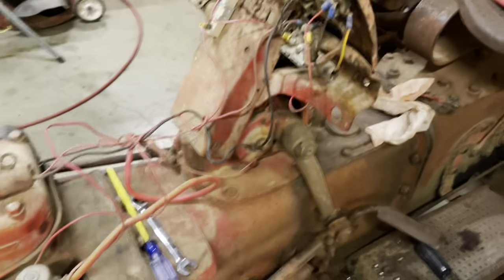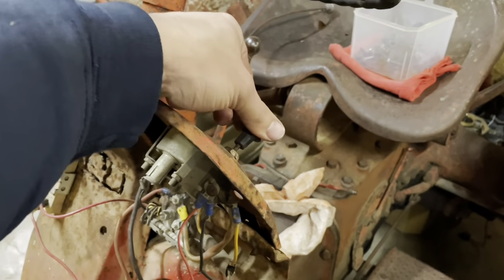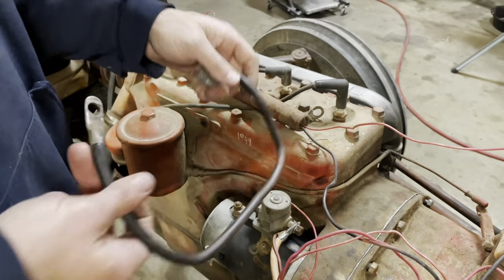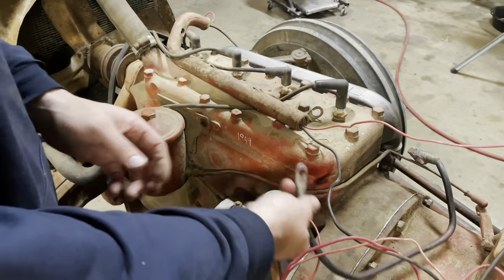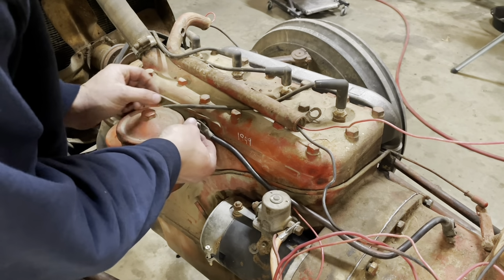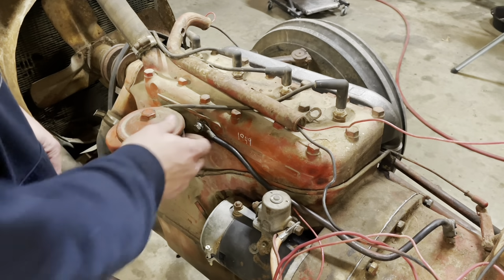And I guess try to set a battery in there, see if we can figure out what happens when we hit the ignition key, which is push button, which is totally rusted up and won't move. I had to go find my negative battery cable. I don't know what they had it hooked to. I think probably the battery tray, which I have not put in yet because I haven't tightened all the bell housing bolts. I'm not going to permanently put anything on this tractor until I make sure that the thing will operate. I don't want to put everything back together and find out that the clutch doesn't work or the transmission's broke or who knows what.